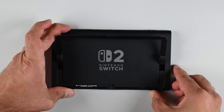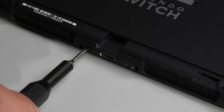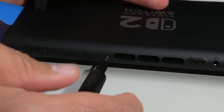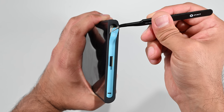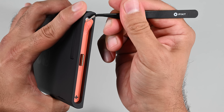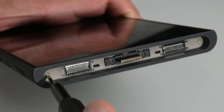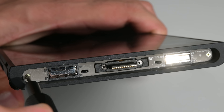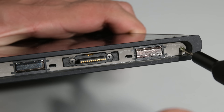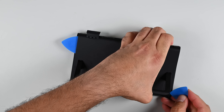Moving to the main console, I'm suspicious of the obvious screws — two tri-point and three Phillips in total. Sure enough, that's not all. Hiding inside the Joy-Con attachment wells are two more screws hidden underneath stickers, clearly visible in our CT scans. To reach those screws we need to remove the stickers, which are more of a pain than they should be. With some heat and a pick we can peel them back, but without at least a hairdryer you'll struggle. Peeling the stickers reveals the magnets and four screws, of which we only need to remove the two outermost. Sending picks around both sides unclips the back panel from the main body — and finally, we're in.